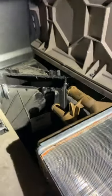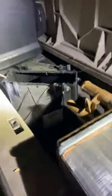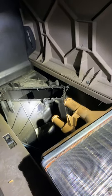So I'll go inside here and show you what I'm talking about. That's the old heater core and that's the new one. You see that casing right there? You've got to cut it off — cut all the way around it. Some people break it apart into pieces or try a razor blade, but it's pretty strong solid plastic. What I used was a utility saw and it worked really well — took it off in a matter of minutes.